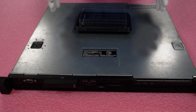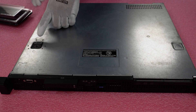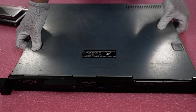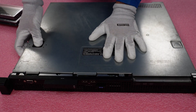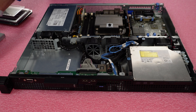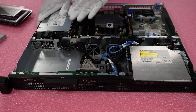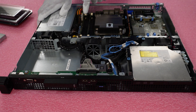I have my ESD gear on. We're safe to work on our machine. All we are going to need is our memory to do the upgrade. And technically, if you have this set to lock, you will need a Phillips head, but most people just leave it set to unlock. So we're just going to go ahead and slide this, push this down, and slide this back. Remove the top. As we mentioned before, one CPU and four DIMM slots.